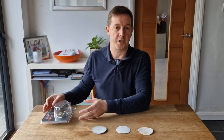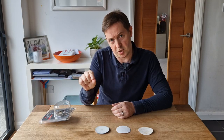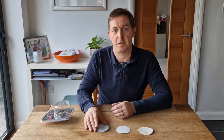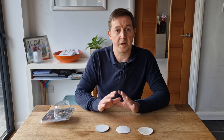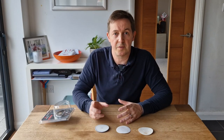So that's how to use the 3M Headlight Restoration Kit to improve the look of your existing plastic headlights if they've gone faded or yellow. Now, in answer to those two questions I posed at the beginning — yes, the kit absolutely works. A couple of observations: because you've got circular discs, you may have seen me struggling to get into that very sharp point at the bottom of the headlight. With regular wet and dry paper and your fingers, you can get into those corners a little easier, but that's minor. It is also worth noting that having polished those headlights, they don't have any sealant or protection on them. The UK is not that hot a country — I suspect it would last at least a year. But if you were somewhere very hot and sunny, you'd want to protect your plastic lenses with something else. There is a technique of using spray lacquer — 2K type lacquer — though it's more involved: you need to mask up the front of your car to avoid overspray, but that absolutely is the belts-and-braces approach to solving this headlight problem.